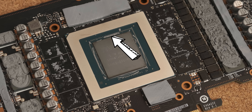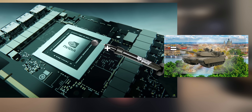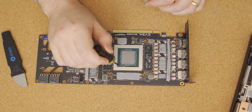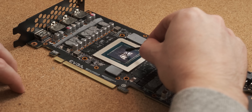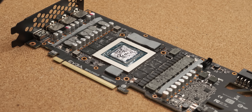The second consideration is you need to protect all of the surface-mounted componentry around the actual GPU die, because liquid metal is thermally and electrically conductive. If it touches any of those components, it'll short them. How I went about protecting these components was by using clear nail polish — putting like three or four coats over all of those components so that the liquid metal can't contact them. With those procedures out of the way, I felt safe applying liquid metal to the GPU die. All the pictures I saw showed a small bobble of liquid metal, and I used the included Q-tips to spread it around to get an even layer. I wasn't 100% sure if I had too much or too little, so I sent a picture to Neo, who was shocked at the amount and said I definitely needed to remove a bunch of it, which I did.